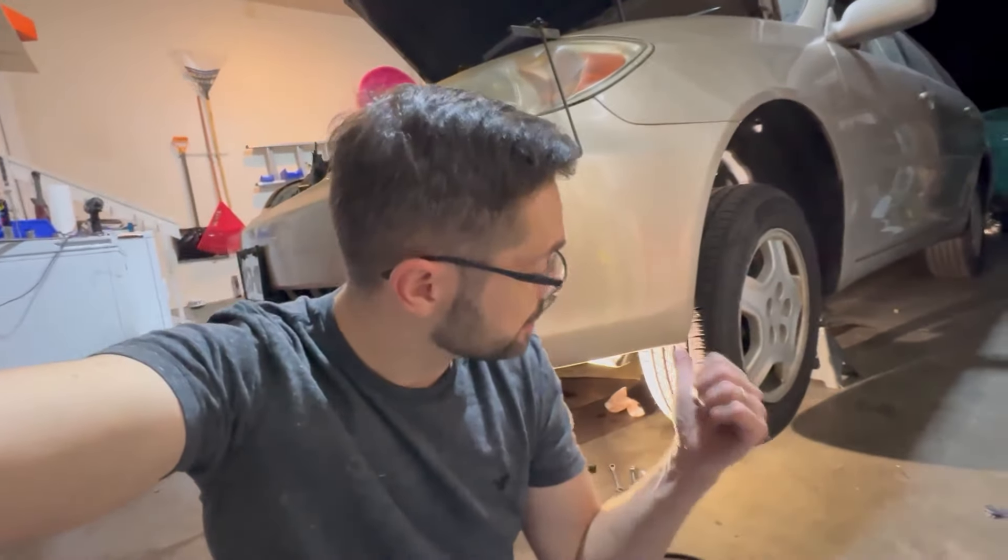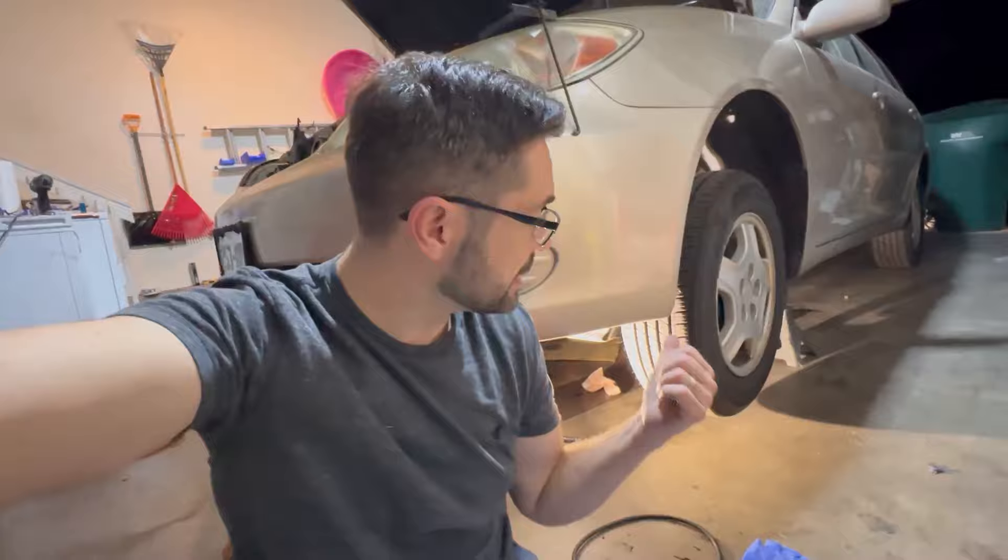Really happy that we found the fuel pump sock was actually clogged for the main car, so we got that on order. Got started on the old project here — we're going to see what we can do. I think we're going to have to pull the transmission no matter what to replace the seal — the transmission pump seal. Got to take it out anyways, but I'm hoping the transmission isn't cooked. If you like it, give a like — really appreciate it. The comments are great, subscribe down there. We'll see you guys on the next one. Later.